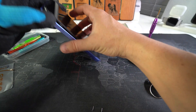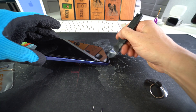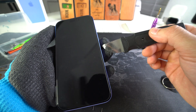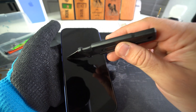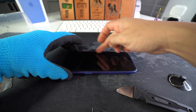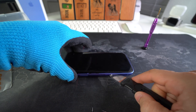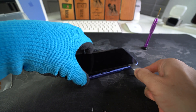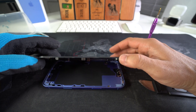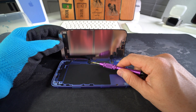Once you've gone down both sides with the prying tool, the only adhesive left will be down here. So we're going to do the top portion now. Keep in mind that the cables connecting the screen to the motherboard are on the left hand side of the screen. We're going to set the phone on its side since the cables are up here and we're going to pull up on the screen this way. If there's some adhesive left over, let's go ahead and remove it first. Once the final clip is released on this corner, we can now lift up on the screen. And as you can see, here we have the two cables that are connected to the motherboard.